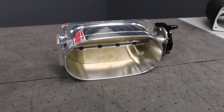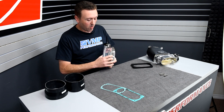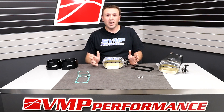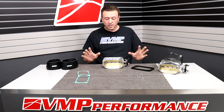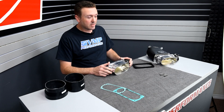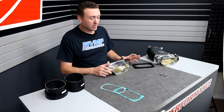You may ask why we're not making an electronic VMP 180R throttle body. The truth is these big blades are really hard for the electronic drive-by-wire motors to actuate. Right off idle they get really pissy, at wide open throttle they get unhappy and randomly close. So we decided to stay away from that for now and stick to the mechanical linkage so we can get our racers taken care of with Holley EFI and such.